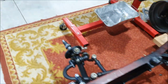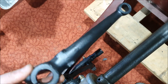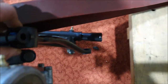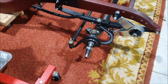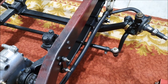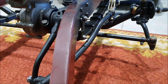I did figure out the difference between the two drop arms I've got. It's not just the fact that one is straight and one is bent - it's also to do with the angle. This one brings the drag link closer to the middle of the car, which would cause a problem because there's not a lot of clearance. When you work the steering one way it's not too bad, but coming back the other way it starts getting close and actually hits the grease nipple on the shackle.